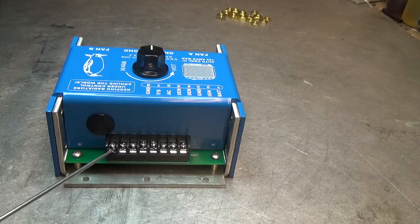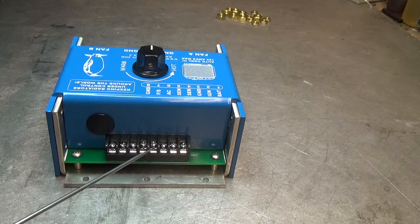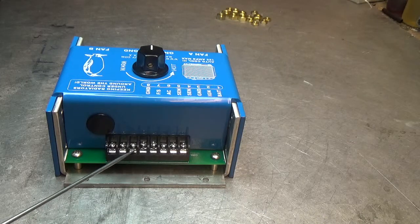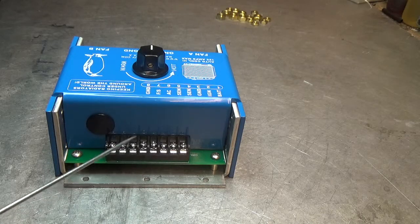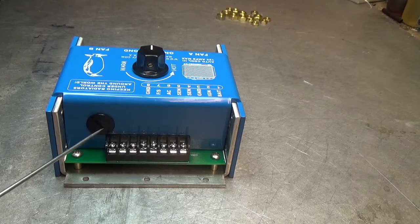Pin 8 is also a ground over here. Your sensor — whatever sensor you have — the two wires from the sensor go to pins 4 and 5. Pin 6 is the AC fan enable, which turns the fan on when you turn the air conditioning on. There's a small potentiometer inside this plug that you can set the AC fan speed from low to high if you want.